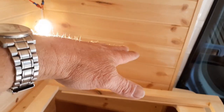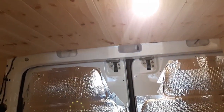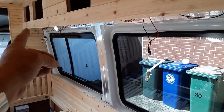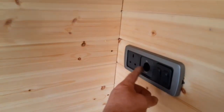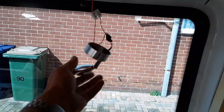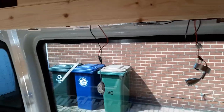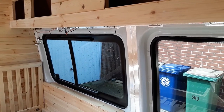Down this side of the van we've got this switch here which is going to be for the light that shines down onto your gas hob. Then we've got a double switch: the first one is the light into the bathroom area, and the second one lights up three LEDs that are going to be hanging down. We've then got your 12V cigarette lighter socket for different 12V appliances, and a 240V plug on the end. We've also got two sockets currently hanging which are going to be mounted into the side — one at each end. That's all the wiring as it stands, but I'll now explain about the split charge relay.